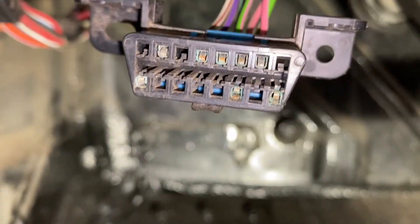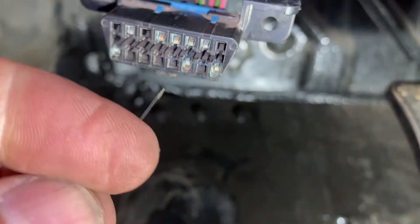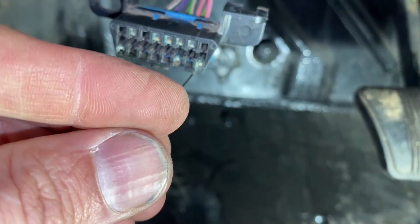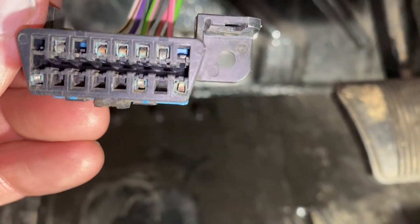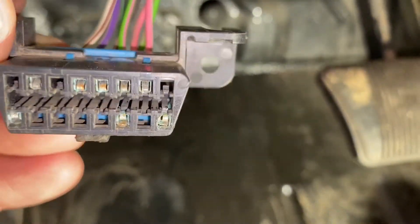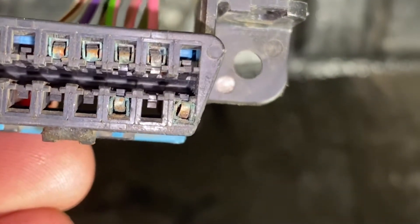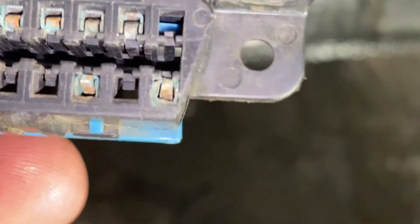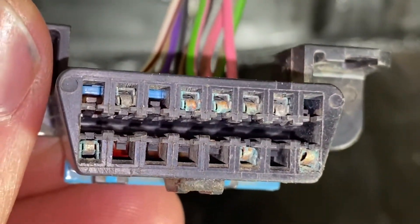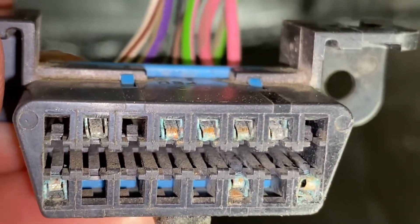I got them all pretty much clean. I was able to get a little pin like this — like for sewing — and get in there. I was able to bend that thing back. Now it is looking the way it's supposed to look. Be very, very careful — when the pin goes in on the code reader, everything's got to push nice and it's got to be clean. So I'm going to clean this a little bit better, blow it out, and let's try the code reader and see if that worked.